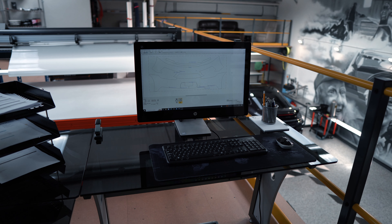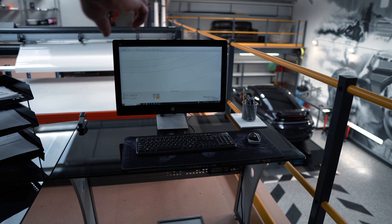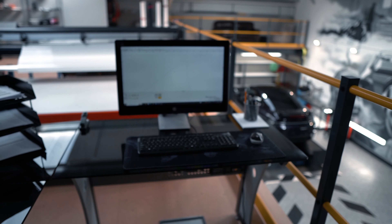Paul explains: he's already been into the template and added material to go underneath the bumper near the bonnet. If you look closer, it's not the same shape as the bottom of the bonnet anymore — there's a notch. That part earlier went down and straight across, but where it goes up is a bit he's added to tuck in, so it'll follow the top of the bumper, go around the little semicircle, dip in, and there's a tab sticking out to wrap around the return.